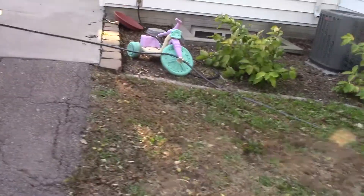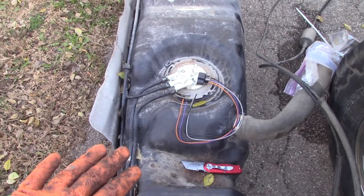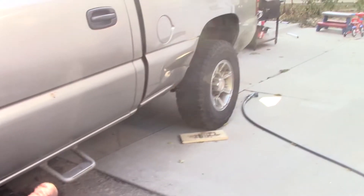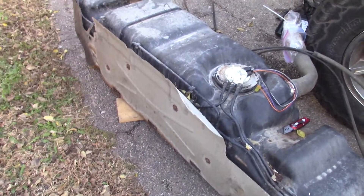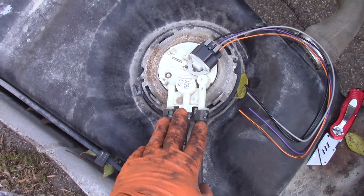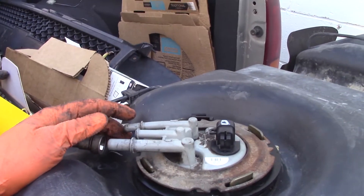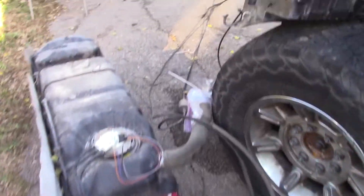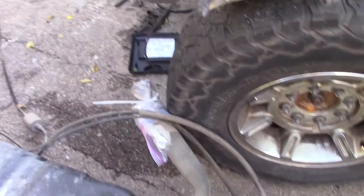I've removed both fuel tanks. This is the gasoline tank from the 8.1-liter truck. However, that truck is an extended-cab long box, so this tank will not fit physically in this crew-cab short-box diesel because the frame setup is different. Also, the fuel connections are different between the gas and diesel — I've got quick connects that are 3/8 and 5/16 on the gasoline tank, whereas the diesel tank has lines that are 1/2-inch and 3/8 quick disconnect. So the lines are all different, and what I'm going to do temporarily is hook up this gas fuel tank using some lines I scavenged from the '94 Roadmaster that's eventually going to receive the diesel. I'm going to hook those fuel lines up to the 8.1.